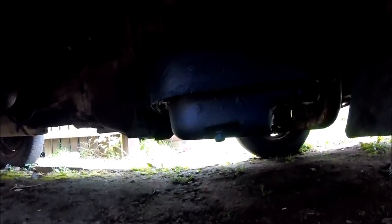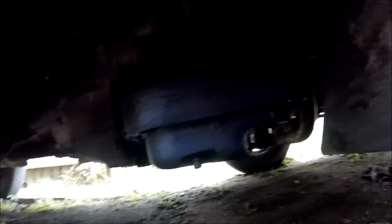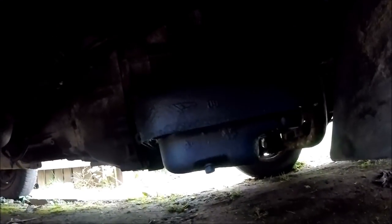All fully repaired — all the old sealant scraped off, full oil change. I've also done a filter change on the engine as well while I was replacing the oil. So that's the old sump gasket fully scraped off and removed, the sump itself scrubbed within an inch of its life to get a nice clean surface for the new gasket to be made. New gasket fitted on, sump refitted, new oil, new filter. A couple of weeks since the repair was done just to be sure there weren't any issues. The van's been started multiple times just to get the oil circulating, moved a couple of times, taken down to the paint shop and back. And as I say, it's bone dry. It looks as though there's been a good repair, a good seal. I no longer have an oil leaking Daihatsu Hijet. That's how I've fully repaired the sump gasket on this little Daihatsu Hijet.